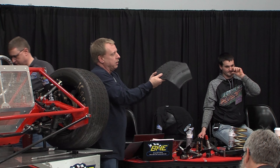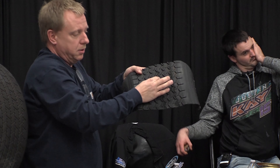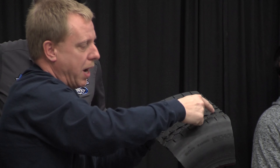This particular tire here has a feather edge. This was most likely a right rear tire, so you would stand on the beadlock side and grind that feather edge off — grinder is grinding this way. What we're trying to achieve with sanding a tire is taking the glaze off the tire and sharpening up those little edges on the drive edges.